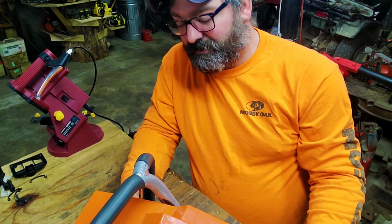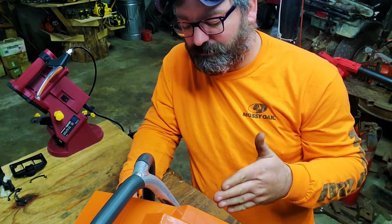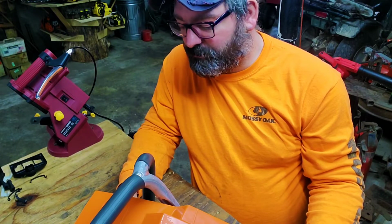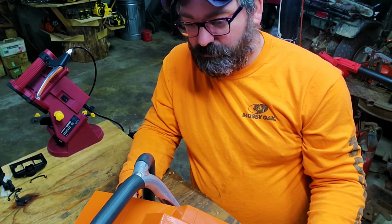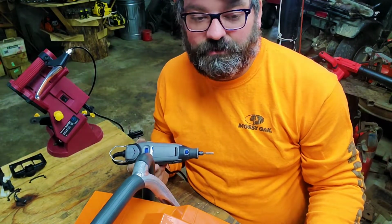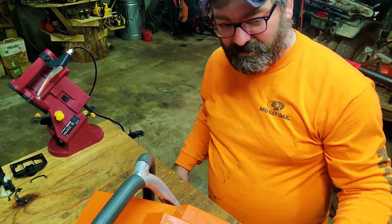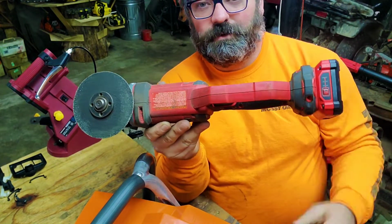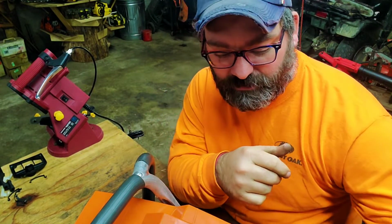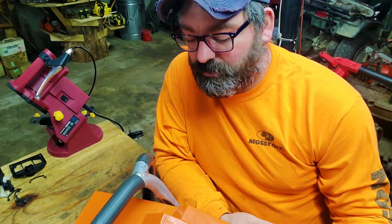But I hope this helps somebody, because it surely helped me watching that guy do his video on his. So this actually helped me. Doing this is a whole lot different than watching somebody else do it. And if you don't have a Dremel, you can use a grinder, but you got to be steady as can be with it. That's why I like the battery powered ones, and you ain't got to worry about the cord being on the back of them, touching your arm and all that stuff, so you can lay it down and just barely touch stuff with it. I worked on battery trays a lot for underground, so we cut a lot of metal with grinders, so that's how I actually got good at using a grinder.